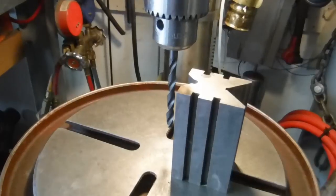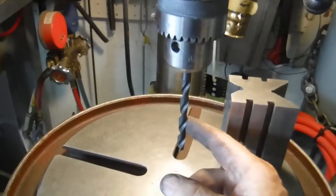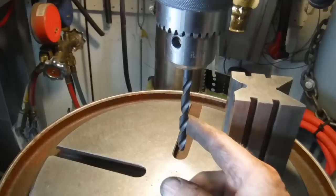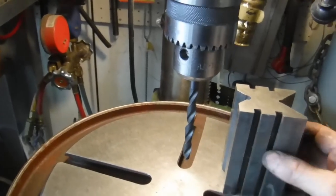It's a buzz killer. Okay, the first thing we're going to do is take that letter O drill. It came with a letter N drill and an O drill. When you do the crankshaft, you start with the N and go in slightly with the O. On the flywheel, you just need to use the O.